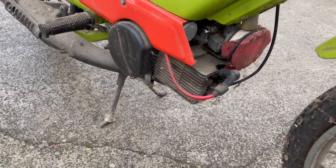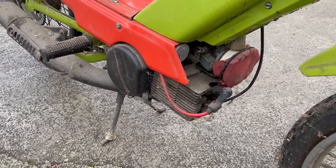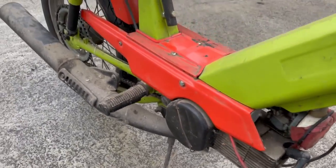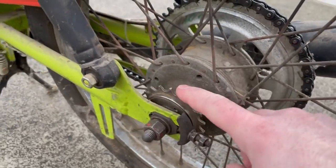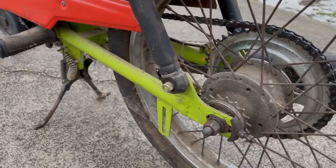The bike originally had pedals, which were used to rotate the compression-free engine around, therefore easily rotating the crankshaft. When the compression was reintroduced, the bike would easily start. You can see the freewheeling sprocket on the other side of the hub. There was a bicycle chain installed here, and through that the engine could be rotated around.